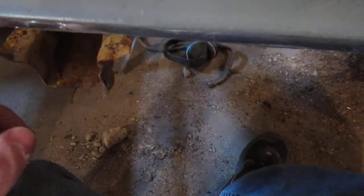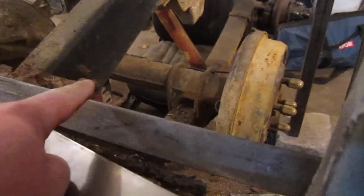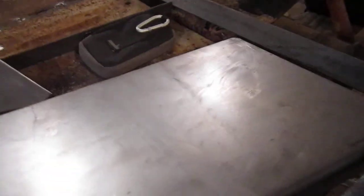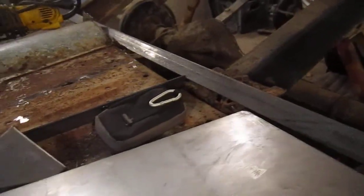This is like nine inches by three-quarters, so it'll give me more than enough to weld to it. That piece gets welded to the inside of this piece. You've got the three supports that are going to go in here — weld all this up, and then I have this piece here that I got bent up. Same thing, three-quarter inch. I'm doing all three-quarter inch bends because the steel place I go to with 16 gauge can only put a three-quarter inch bend on it. I think the factory might be a little bit smaller, but this is not a factory restoration — I'm just trying to get it looking good, definitely going to be driving, not going to be falling apart. It will be solid and probably stronger than OEM.